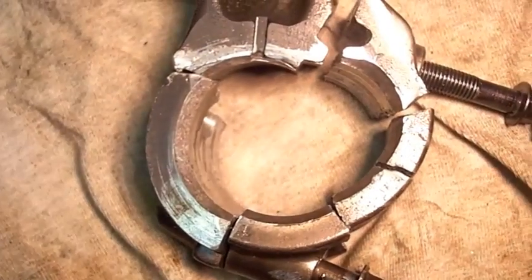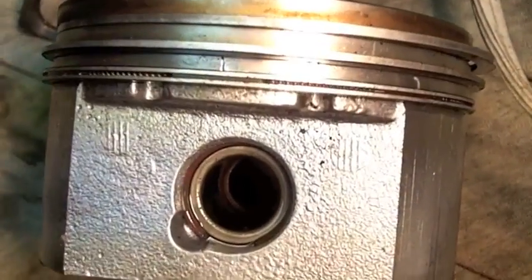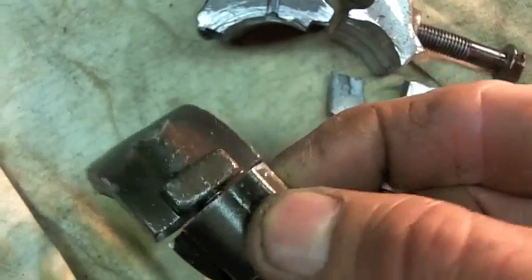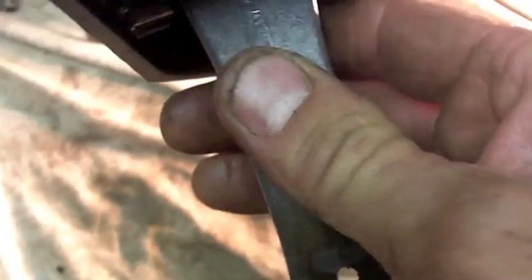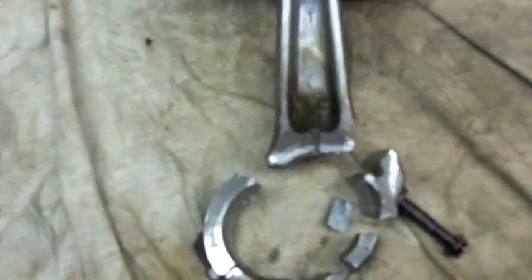Here's our money shot right here — I found all the pieces, the main components of our failure. I'm no expert, but something tells me a connecting rod should not look like that. The piston's in good shape — standard bore, never been into. I figured I could get the TIG welder out and probably get that back together, right? It just grenaded. Crazy. But I have all the pieces and the skirt for the piston's not busted off. I'm gonna clean all this up really good.